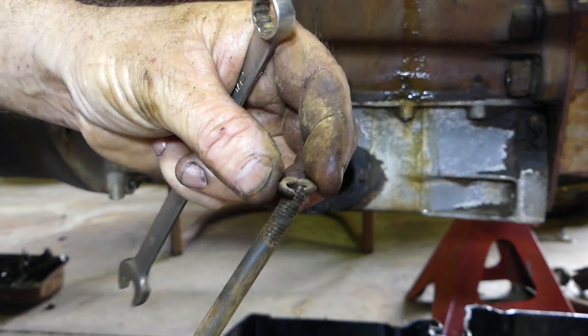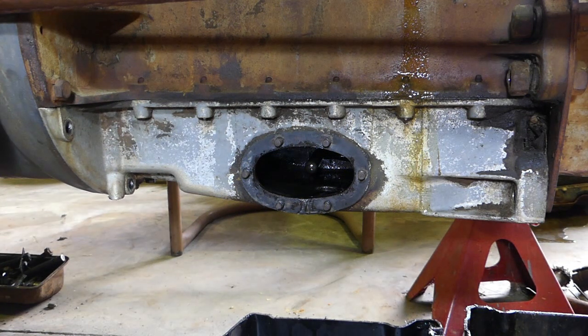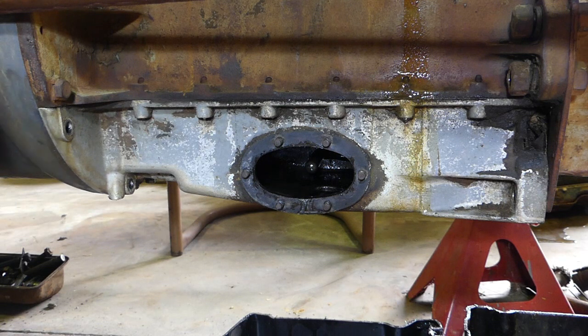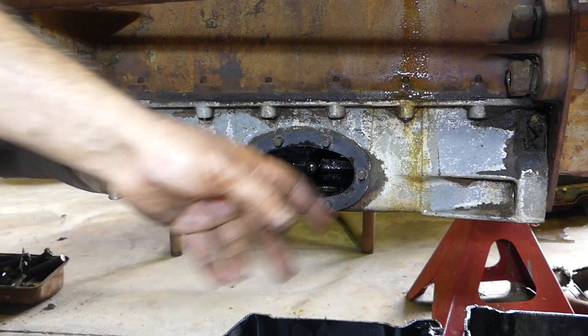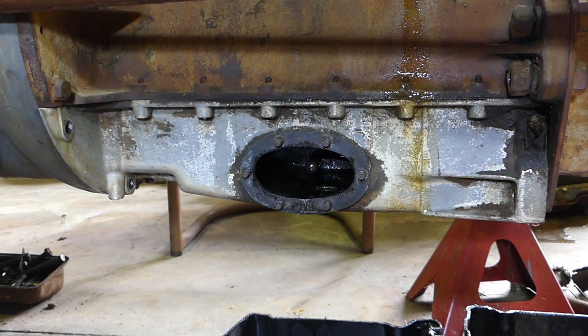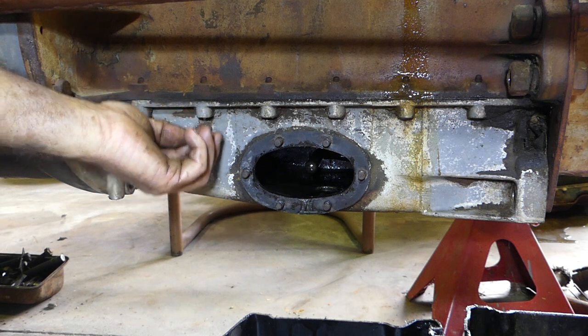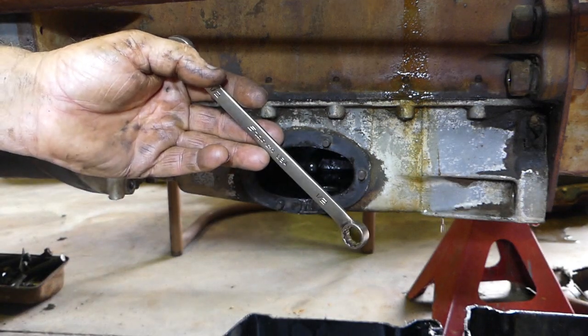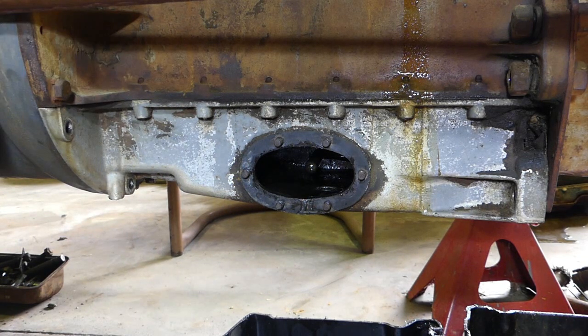The split washer on that one is past it, but we'll probably put new washers all around anyway - for the price of it, it's just worth doing. That's the right-hand side done. I'll go around the left-hand side and won't film that but it's the exact same thing apart from the suction screen. Make sure you've got all the back ones undone, the two on this side loosened with the bottom one out, same on the other side, and all the half-inch bolts along here. You may find that a socket won't fit over the nut and you have to use an open-end spanner, which is what I did here.